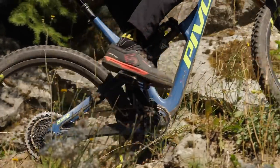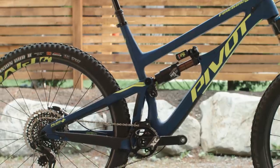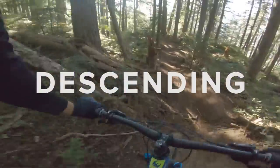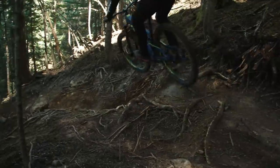It's a combination of two things — it's not just the seat angle, you also need to look at the chainstay length. It's a very short 432mm chainstay on this bike, so if you think of a triangle between the bottom bracket, the rear axle, and your seat position, the higher that seat goes the further over the rear axle you're going to go, leading to more weight on the rear axle, a lighter front end, and maybe a little vagueness when climbing. But I'm just super comfortable from the outset — I can ride into pretty much any terrain. There's plenty of room to maneuver, and even though the bike is so long, it doesn't feel hard to move around. It's pretty light and responds really well.